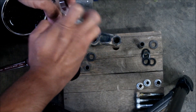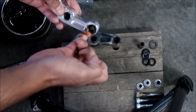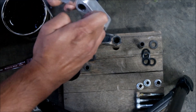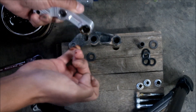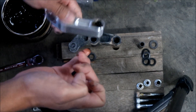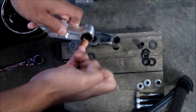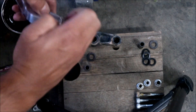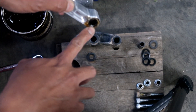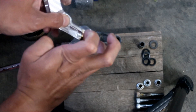Hopefully the bearing doesn't come apart. I have to say the construction of this is very nice — it's very similar to the stock, which is already a nice piece. Just continue to pack it with grease and rotate it so the grease gets in there. One thing that helps is if you can try to force the grease between the bearing race and the aluminum part.